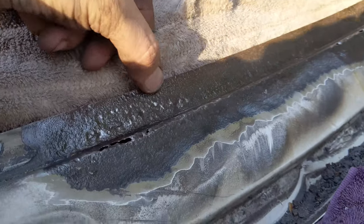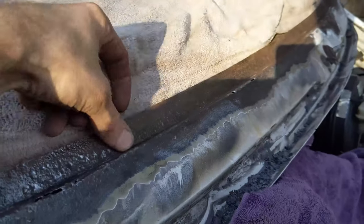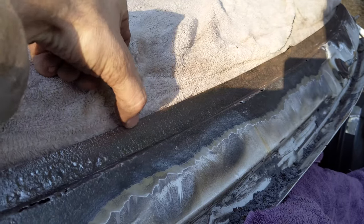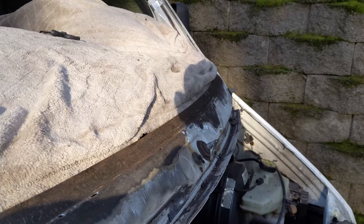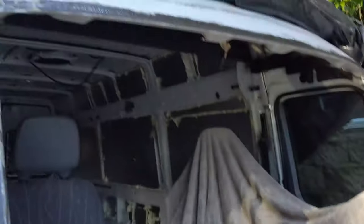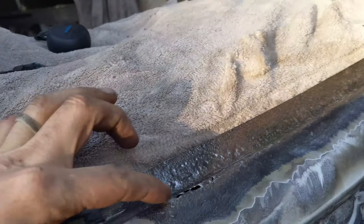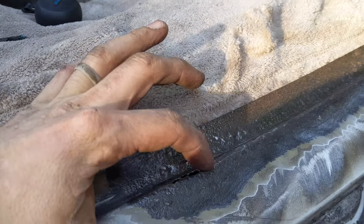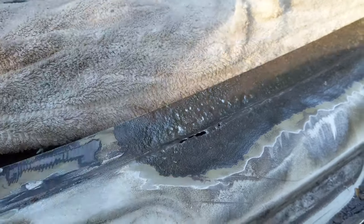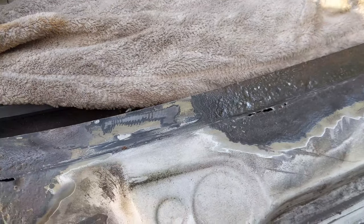For all this, I think I'm going to take my grinder and see if I can grind it flat, because I don't really trust all the rust to be out of there with all those divots. I'm going to do that on the top and the bottom, get that flat. Then I'll open these up a little bit and probably cut this and weld a small patch in each of these little holes — probably my best bet.